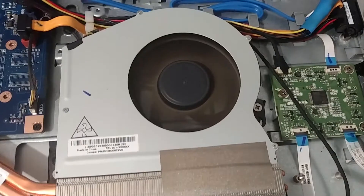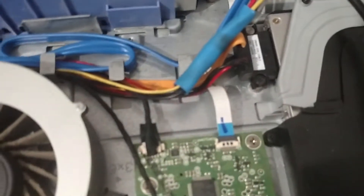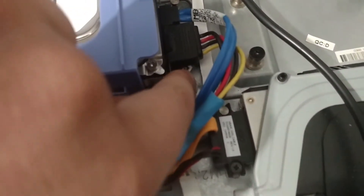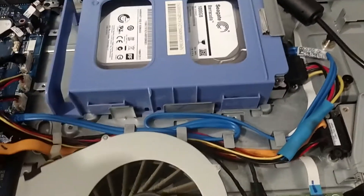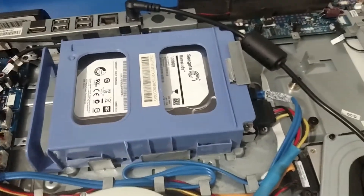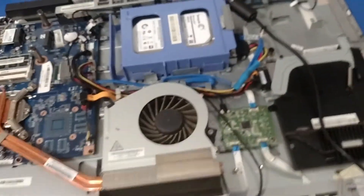I got the machine back on — it says 'no operating system found,' but you can see it is working because the fan is spinning. I got the standard SATA cable and made an adapter. It's not the prettiest, but it is spliced and soldered. I Dremel-tooled off the little stub, plugged in the SATA, and it works. I don't know why they felt like they needed to use a special plug, because desktops don't have special plugs — they just have normal ones. But it works now, so I'm going to put it back together and get Windows installed.